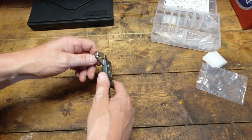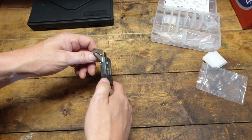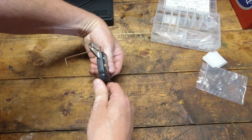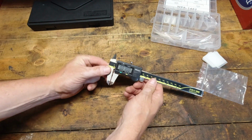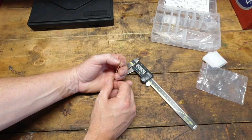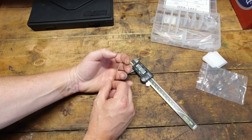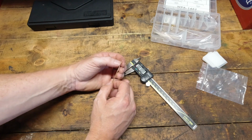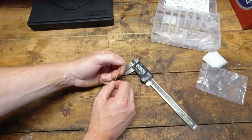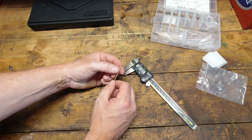Maybe just a hair up. Again, the way the rods are, they're not that deep, so we're kind of out of the effective area of this. But we're on there tight. Rock that out of there. And it's 0.070. So the part where you're going to need the most fueling is too big. It's too big of a restriction. It's not the actual calibrated 0.037 that it should be. It was 0.040, 0.039, 0.040. The regular cruising side of things on the 0.070, I would call that where it's supposed to be.